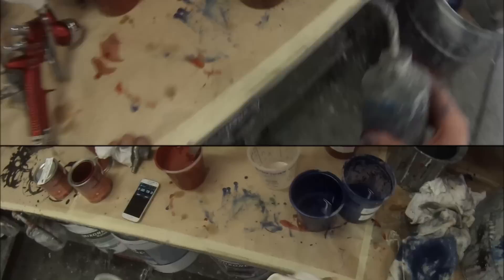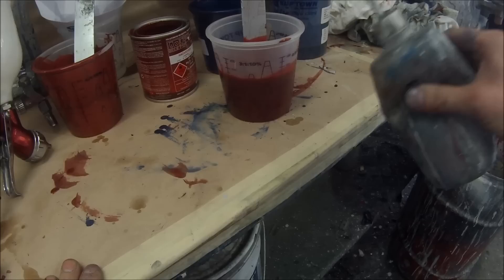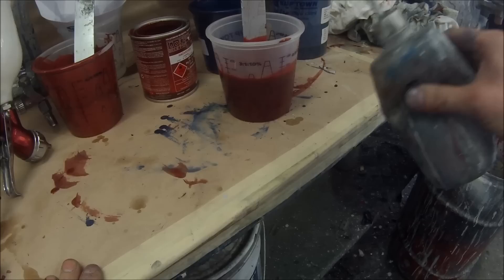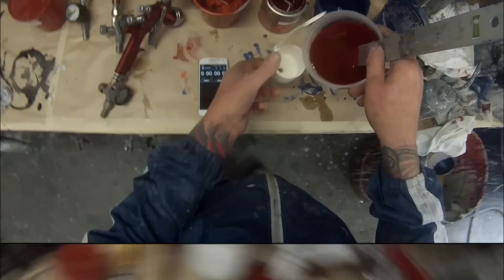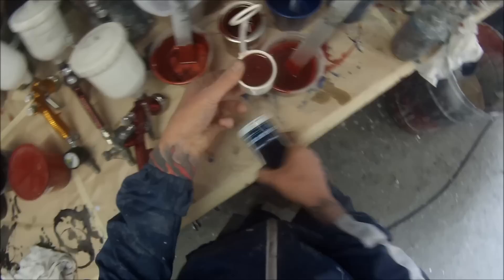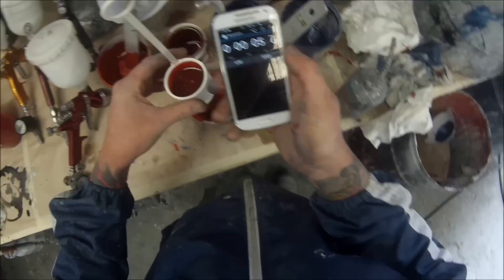This is our candy colour here - same as the other base coat, it's a 3 to 1. So I'm thinning it down again at the same ratio and we'll take our readings. Hit that subscribe button to keep up to date with the rest of my work. I'll be uploading the colour matching on this same candy - how to colour match and how to spray paint a candy car. So we're just running it through.